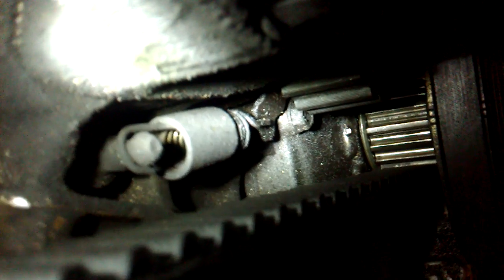The biggest thing that confused me was the crank pulley. They tell you there are three notches here and one in the back. They want those three to be in front of the timing notch. I was using the timing notch the book told me to go off of, which is just that little bitty spike sticking out of the block — it's real little. That's the one they tell you to go off of if you do not have your valve cover.